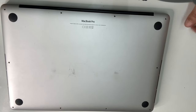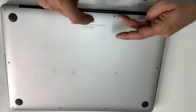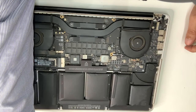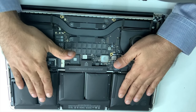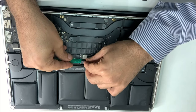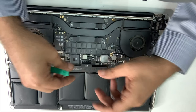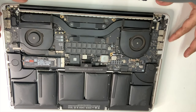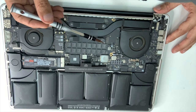The solution I found is to remove all the screws of the MacBook Pro. After removing the cover, keep it safe along with the screws. Here's how it looks — the battery, which I remove by taking off the sticker and disconnecting the connector here to make it safe, ensuring all power has been removed. Then there are silver screws, one here and one more.